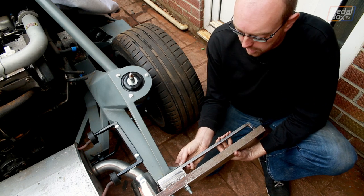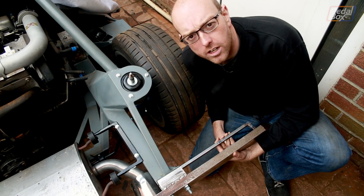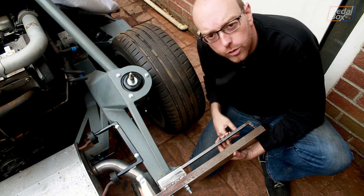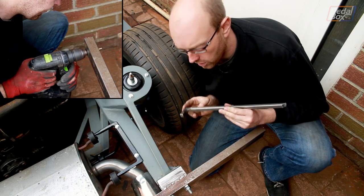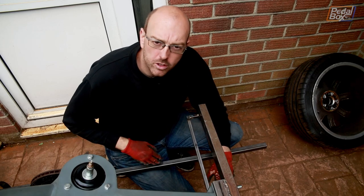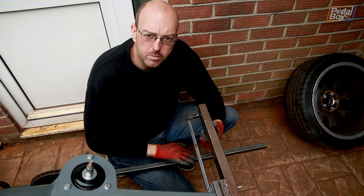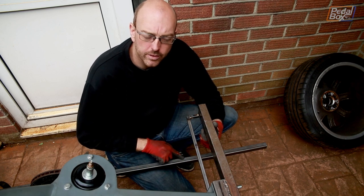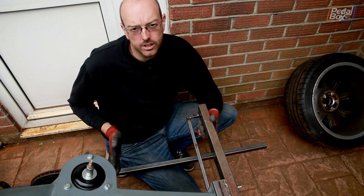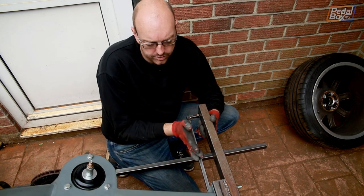These extensions will fit on and give us a position to weld the arch onto coming round, but this needs to extend all the way down to the bottom of where the car will sit and where the floor is going to go. We need to pop the wheel off, jack the car up, and put something down the edge of the car to work out exactly where we need. I've also clamped a piece of inch box onto the floor all the way from the front of the car right the way back, so we can measure from the underside of this extension down to the bottom of the floor — it's about 280mm all the way down. Now we've got that, we can take the steel off, put the wheel back on, and start measuring for the distance to the back of the wheel arch.